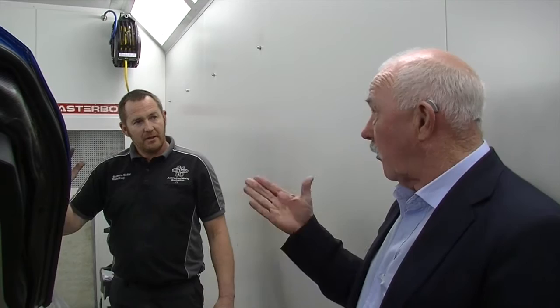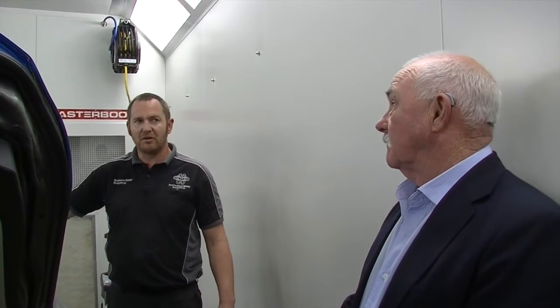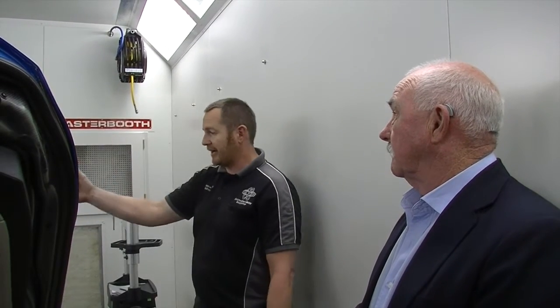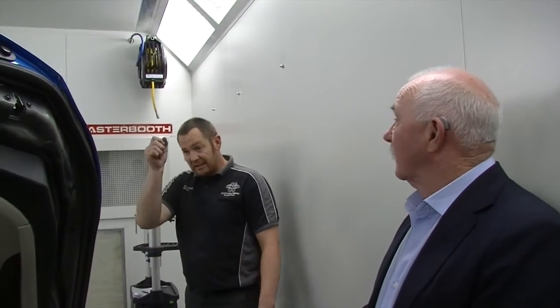So how is the aluminium front and rear section joined to the carbon fiber? The rear is bonding and the front is glued. So the aluminium is glued to the firewall — it's purely bonding? Yes. There are a few bolts, but the majority of it is glued. It's quite a big job to cut through it, pick it away, and literally heat it and peel it off. On the training course, it's quite a job to get it off.